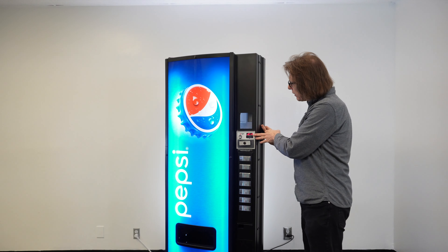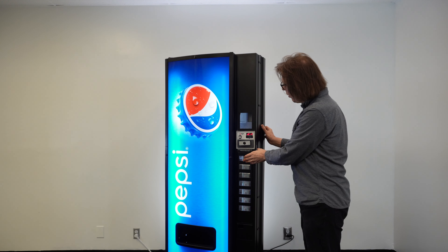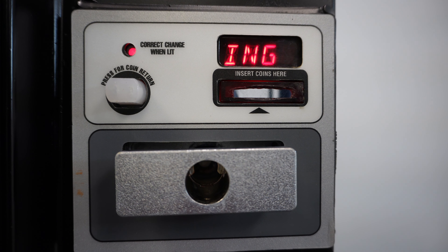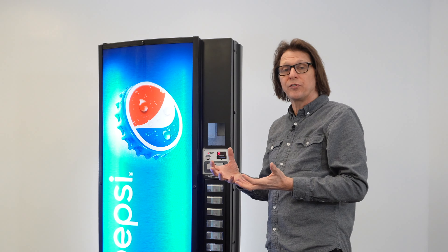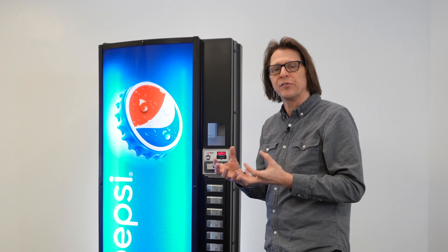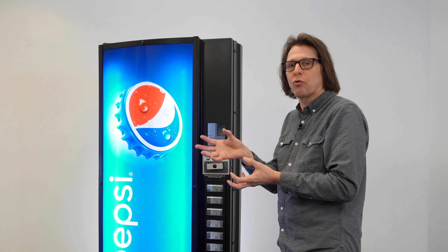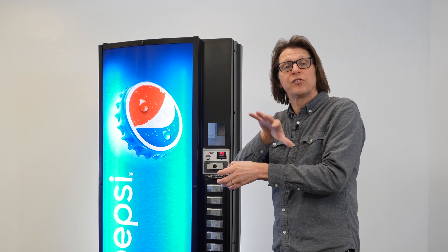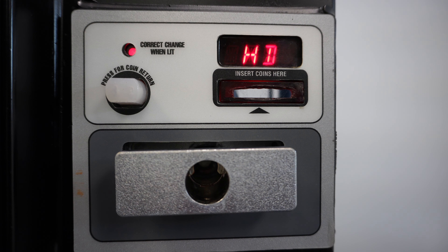If I wait periodically, it will eventually say HD. We can force this by pressing selection button one and holding it — it's going to start saying 'homing' across the screen. What this does is the computer board tries to apply power to that motor to turn it back to its home or start position. What would happen is you would hear the motor trying to turn to get back to its home position. If it's not getting back there, something is stuck in there and you'll need to remove the product.